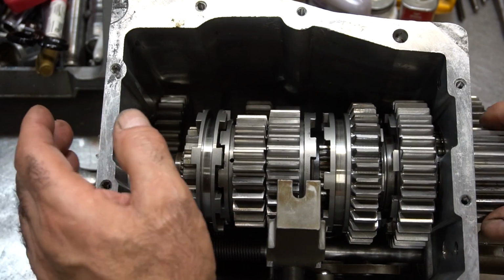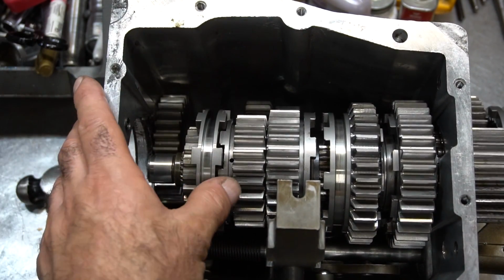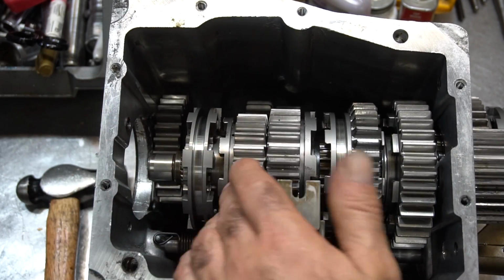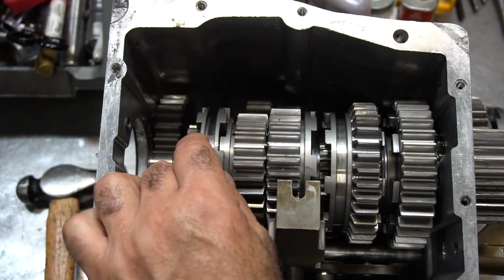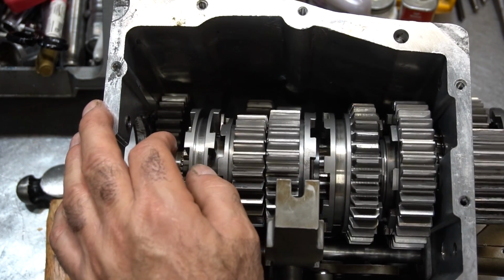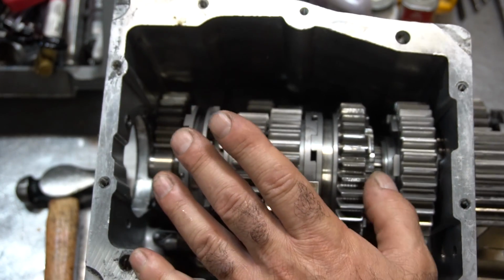So this is a JT5 Rally clutchless gear set. I had removed the input shaft a long time ago. It's been sitting in my shop for quite a while. It's an 8-lug dog ring type design. Some people call these face-plated gears because they are engaging along the face profile of the tooth. It's not a lug design that's straight like this, so it's kind of a face tooth contact. Again, it's an 8-lug system. Basically, it spins, boom, goes into gear like that.